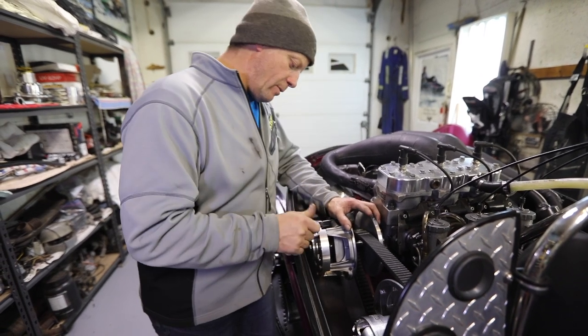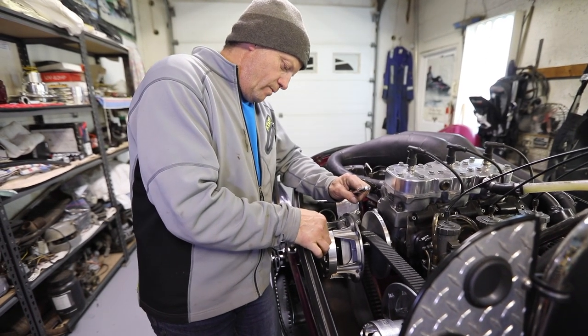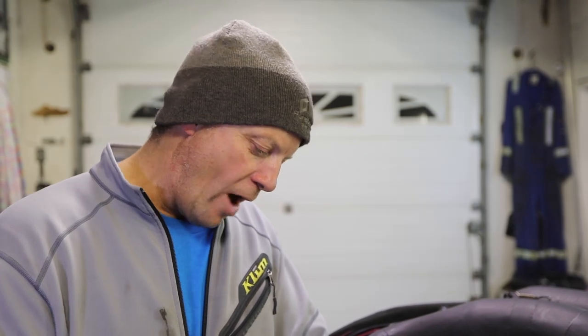It's a little bit of a time-consuming thing compared to the weights, so what I like to do is take every second bolt out. If your spring breaks on the mountain, you're going to lose a ton of RPM. So instead of your sled revving at 8,000 or 8,200 where it's supposed to be, it's probably only going to be pulling about 7,000 or 6,500. If it's a big drastic drop in RPM, yeah, your spring is likely broke.